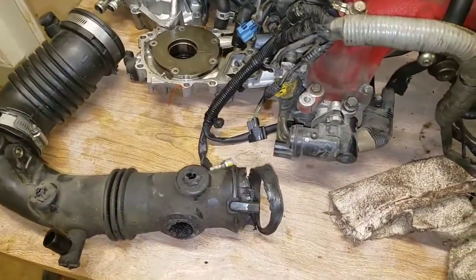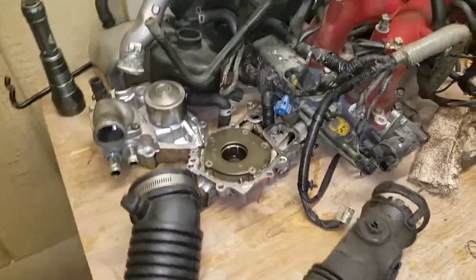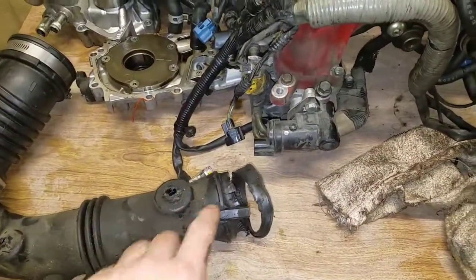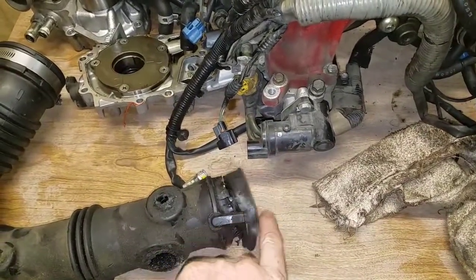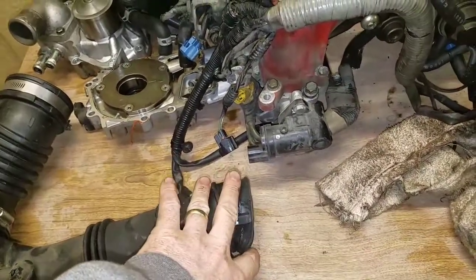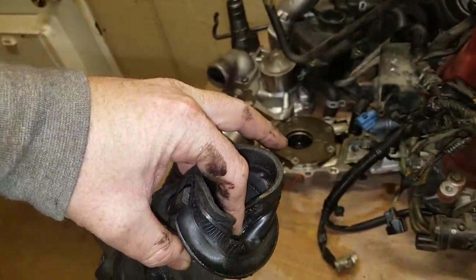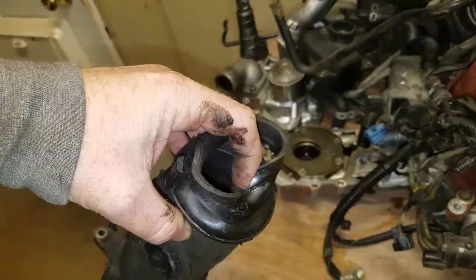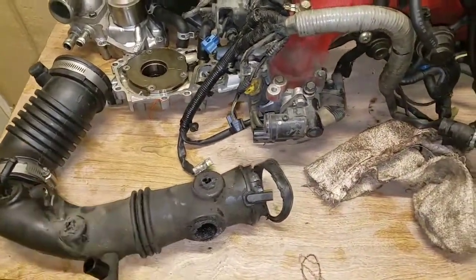This is definitely something you want to watch out for with these boots. If you've got the stock one on there still, check it. I looked at this car when I bought it and because it had that hose clamp over it, it looked like it was together - but it actually wasn't even hooked on the bottom. My other one was even more messed up - it was folded inside, somebody stuck it on folded in, and it had a big flap blocking the turbo. Luckily that one didn't burn my engine up, but this one did.